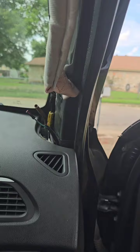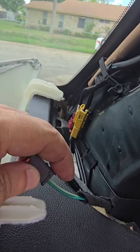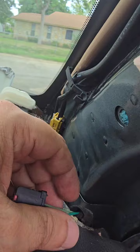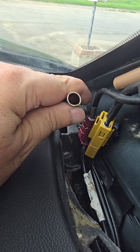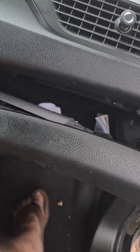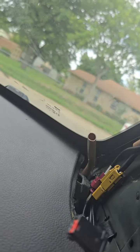To fix this, I'm going to remove the console cover on the top, on the left-hand side, on the right-hand side, and on the passenger side. There's a speaker that is easily disconnected by removing that clip. I've already cut the original lining and removed the shelving inside the glove compartment so I can reach in from inside.